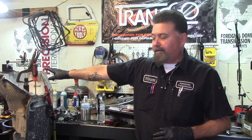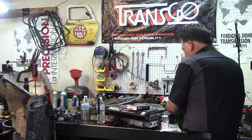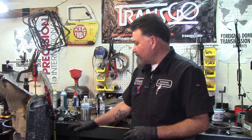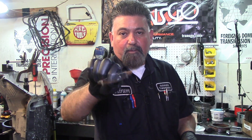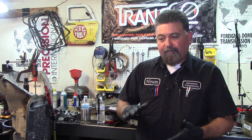I've got my dial indicator, some pliers, and a screwdriver lining my pump. I only have two bolts torqued on the front pump, and the planetary gear assembly is not completely assembled - both planets are out. I did the rear clearance and got it pretty close, and I was doing the front clearance when I found I have a lot of clearance there. In between both planets it takes a plastic washer, which I replaced, but it's very easily overlooked.